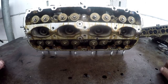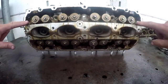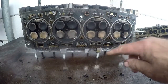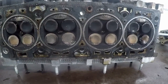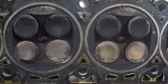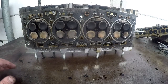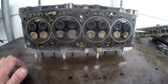I've got the Fiat Strada 1600 cylinder head stripped. As you can see, there are no camshafts on. But when I turn the head around, you can see that all the valves are bent — all 16 valves are bent. This is the result of the cam belt breaking. I need to just emphasize the importance of checking and replacing the cam belts at their recommended intervals.